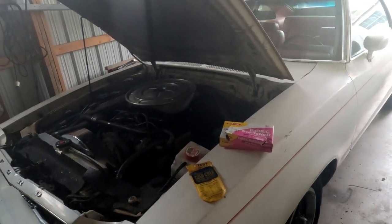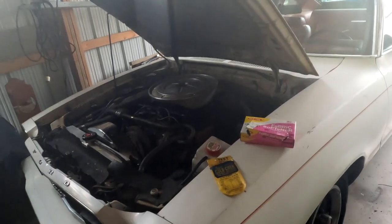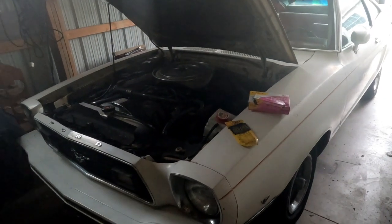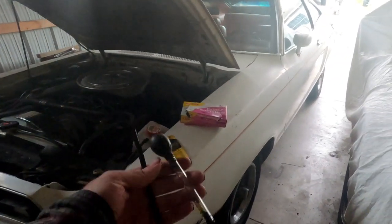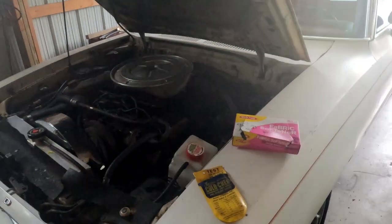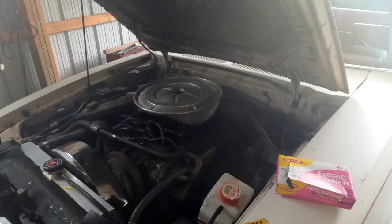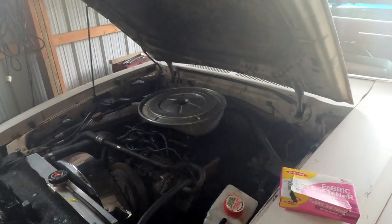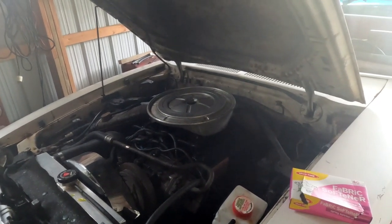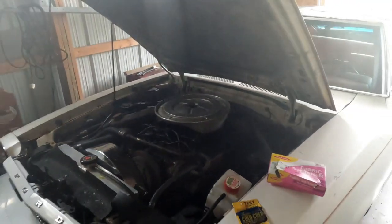So that's all I have for this episode — how to winterize your classic ride, or for that matter how to use one of these to check your daily driver. You want to make sure the fluid in it is right and you're not going to crack the block. It's very important to check that out once in a while, especially when winter time comes.